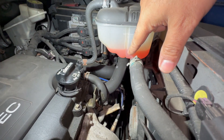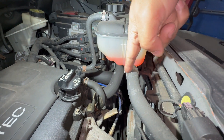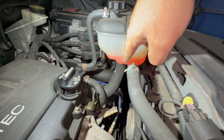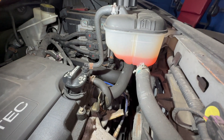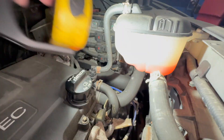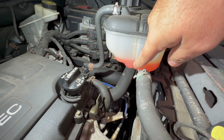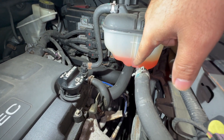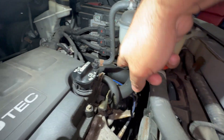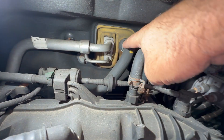Make sure your antifreeze is full — this one's a little bit low, it should be up to here. Once the pressure builds, it's going to probably push it down. You want to get the same antifreeze. If you can't see anything in the bottle, you can put a light behind it. If it's in a tight spot, zoom the light in and you will see. This has got to be full. Even if it's a little low right now, it's still going to give us heat — but it can't be empty. The engine heats this antifreeze up and it then travels inside your vehicle's heater core.